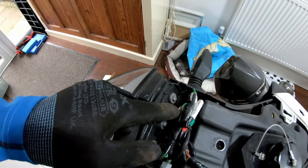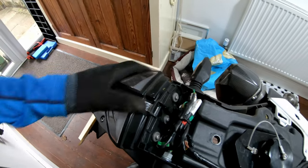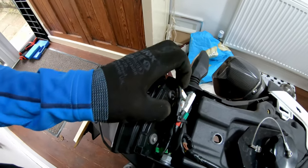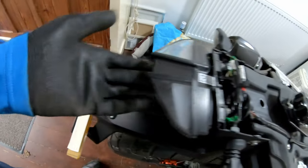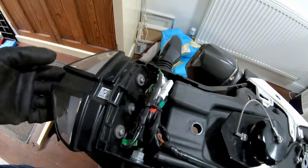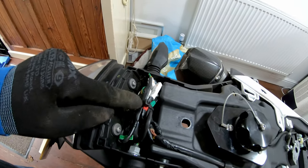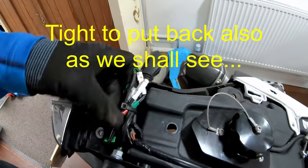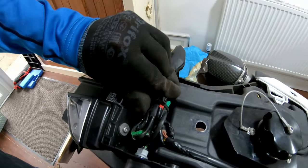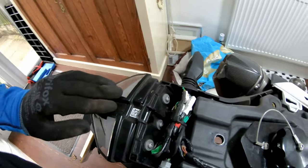It's not activated on the 690. I'm guessing they just use the same components on different bikes and just activate what needs to be for the job. As they've got this number plate light here, they don't need the one there, so it's not activated. We just need to put some power to it and it should work. In theory. I have to cut that cable tie and unravel all these wires, but I'll just have a quick look at how they're in there first. Okay, all nice and dry and clean in there as well. Well designed. Waterproof.